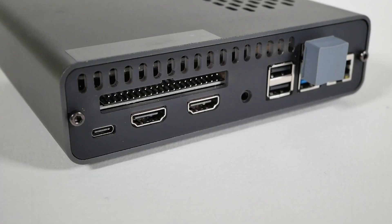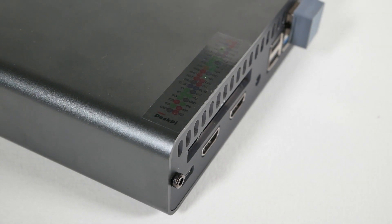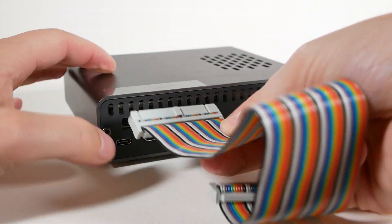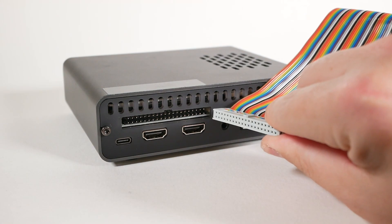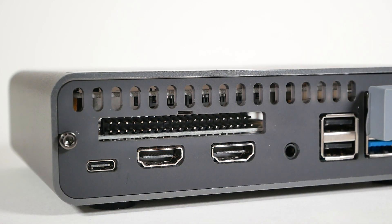I'll link a couple of drive options you can pick from in the description. So is everything perfect? No. There is one issue I came across during assembly of my Raspberry Pi and DeskPi Pro: the 40-pin header. It is exposed and available for ribbon cables, however upon closer inspection I noticed that the ribbon cable itself won't fit in. This is due to the headers being installed too low. This would be a pain to fix because you would have to resolder the entire header, and the easiest workaround would be to sand down the connector to make it fit. But that's not something you should be expected to do, so I'm going to submit my feedback and hope that it gets addressed.